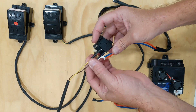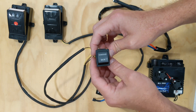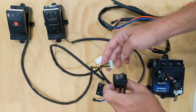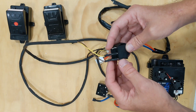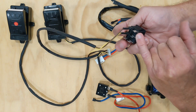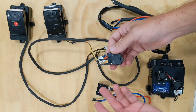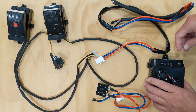Your forward and reverse switch will come detached from the wire harness so you can cut a small square hole wherever you want the switch to be mounted on your dashboard. The cord is about 20 inches and will need to reach the speed controller unit. Once you cut your hole and put the switch in, put your brown wire on the bottom and your yellow wire in the middle. If you get them backwards, forwards and reverse may just be switched — just change them around, not a big deal.